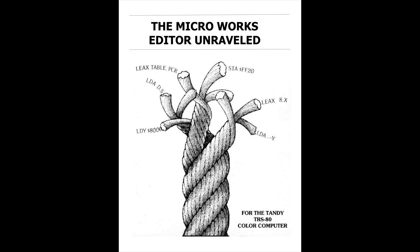What does it do? Well, the name kind of gives it away, right? Its job is to load text from a disk file. The basic loader has already located and opened the file, and the load program then grabs the data from that file and starts storing it in the Coco's memory. It starts at the address pointed to by TXTPLO and keeps going until it gets within about 320 bytes of the end of available RAM and GRAM. Okay, so it's reading the data from the disk and putting it into RAM, but there's a bit more to it than that, isn't there?